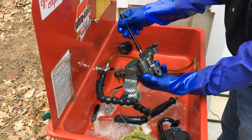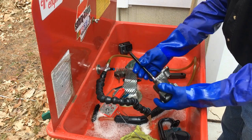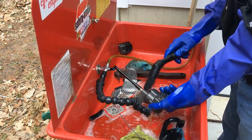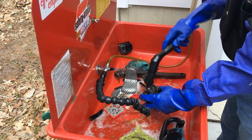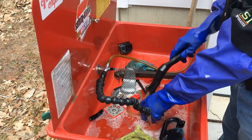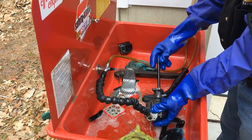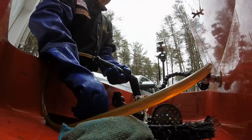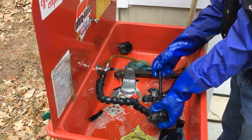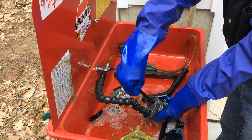The oil pump comes with this shaft, and you have to kind of hammer it on. So that's on there really good. What I do not do is open these up and fill them with grease. I prime the oil pump before putting the intake manifold on. Turn it backwards.